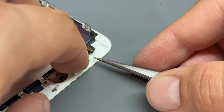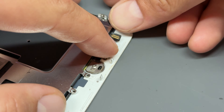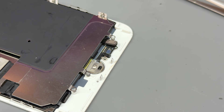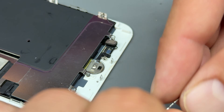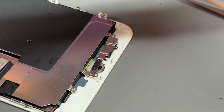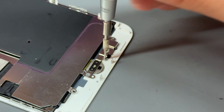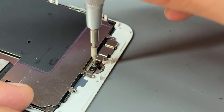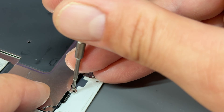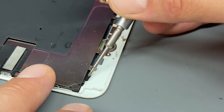Lift that cable up over the top — I always like the way this works, that sits on top of that. Stick the little shield on there and then get the four tri-wing screws that hold those down. There's one crosshead screw that holds the bottom left of the shield in place. That little bit of straight cable here — don't worry about it, it's now disconnected and dead, so there are no live ends to worry about.